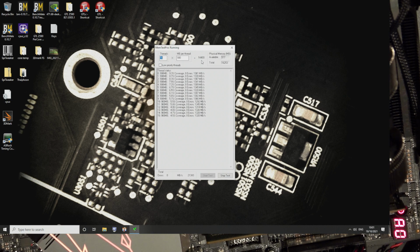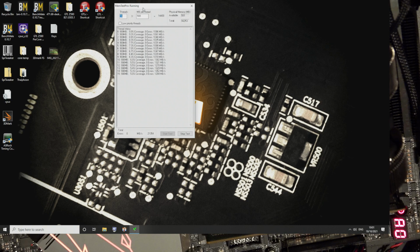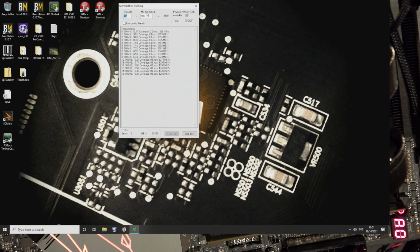But yeah, I'm not going to run LinPack on this because of the air cooler at 5.1 gigahertz. But if the sticks themselves can sustain this kind of overclock, that's honestly impressive. It's a 2666 CL19 OEM, super downclocked. Okay, we got an error. But honestly, with a few more timing adjustments, I'm pretty sure I can clean this up and get it to run at this kind of clock speed. That should not be too much of a problem.